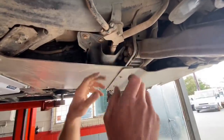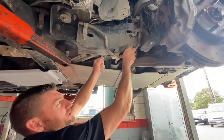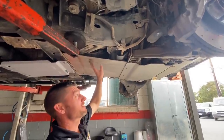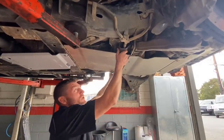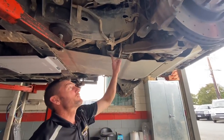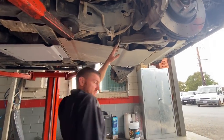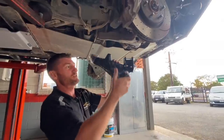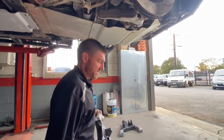That particular bolt fouls against the HBMC line. You want to be careful not to yank or pull on them. If you loosen the three 13mm bolts here, that gives a little bit of play so you can get that bolt out. Bash plates and the HBMC protection plate need to be removed so we can get the HBMC line - loosen them so we can move it up and down without doing any damage to those lines. Get rid of the plate, undo the 13s, get a little bit of flex, and you can get that bolt out. Then it's just a matter of putting it all back together in reverse - not a hard process.